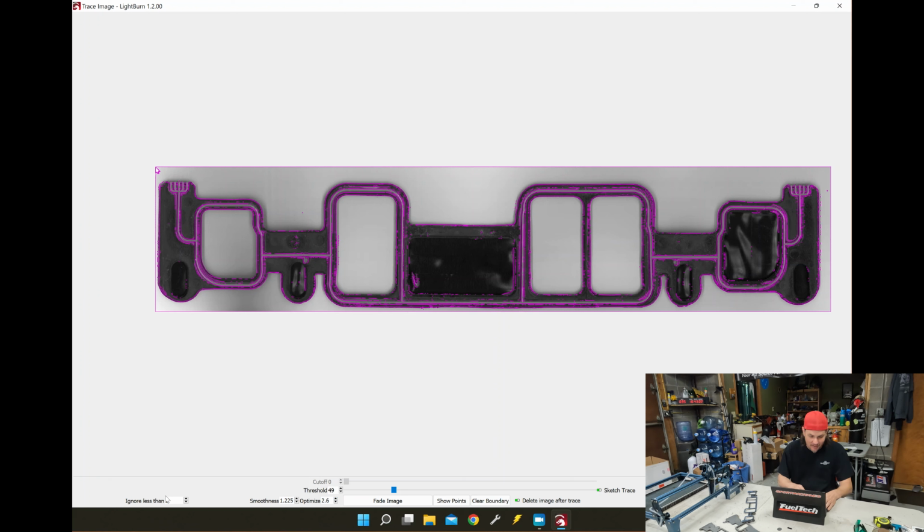Do the same thing for the other side and then just compress it. Put some weight, it doesn't take a lot of weight. We're just wanting to keep the thing flat so the glue adheres up. And whenever we finally get done, there's just a little bit of wobble in this one, but whenever it is mounted up to the heads, we can use some tack to put it down to the heads, and it will flatten out whenever the manifold goes on. And we're going to have a nice cork gasket in the middle to compress down good sealing surfaces on both sides and have a leak-free gasket, hopefully.